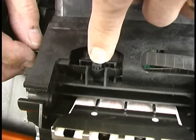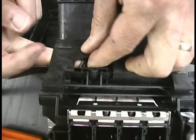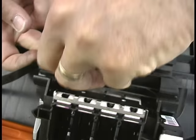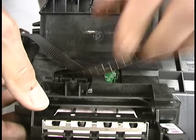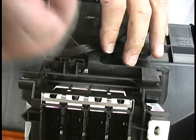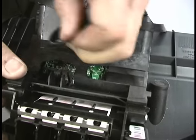If we look at how the belt is actually attached to the carriage, the teeth match up to some teeth here. I usually like to try to feed this thing up through and pull it out this way so that I'm not fighting the little channel on the inside. You can use a flat-blade screwdriver and pop this up — or your handy-dandy pocket knife, whatever works — and that's how it comes out.